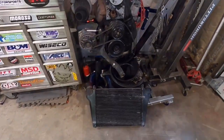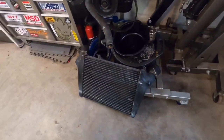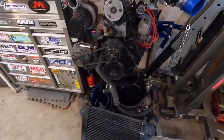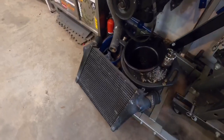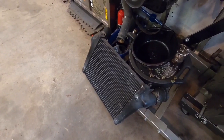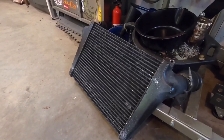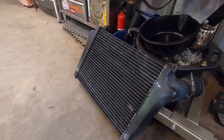That covers air-to-air intercooling. One great thing about air-to-air is you literally just buy the cooler and bolt it up — no water lines, no pumps, no reservoirs. That's what you'll find on about 90% of turbocharged vehicles. Most factory stuff is air-to-air, and the majority of even aftermarket builds use air-to-air due to its simplicity. They don't cool as well, but they don't require any additional components.